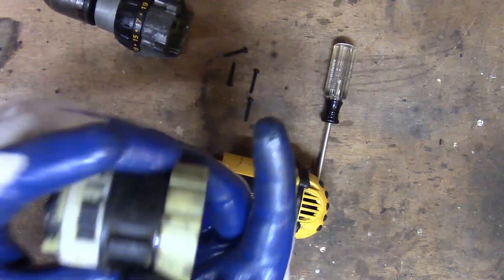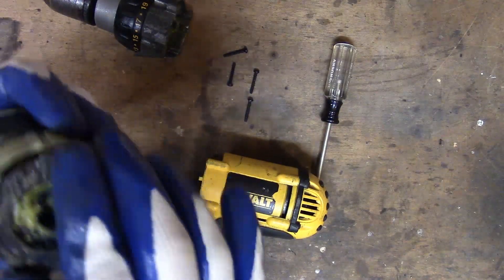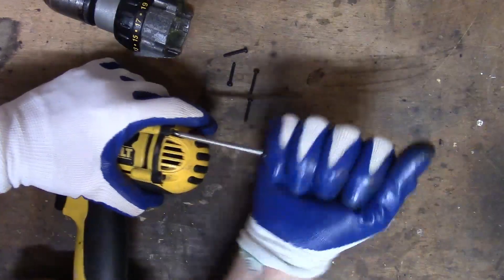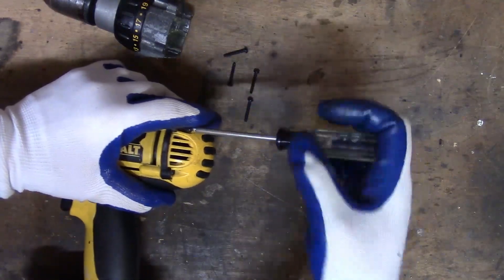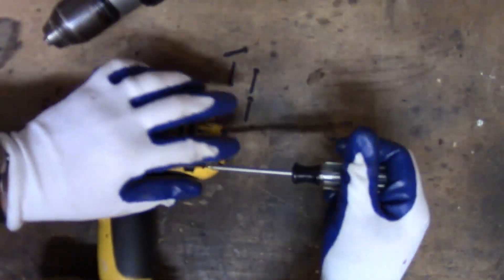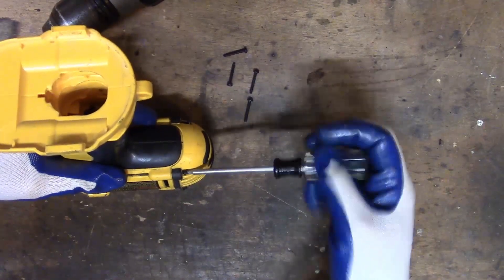Notice all the gear grease and goop that's in it. This is the gearbox — it's basically like a transmission, essentially. I'll put that back together in a minute. So now what we need to get out is the motor. The motor's in there pretty good so we'll have to take the back off of this. Basically what I think has happened is one of the brushes has cracked inside of this thing, and that's why it's just letting out the magic smoke every now and then.